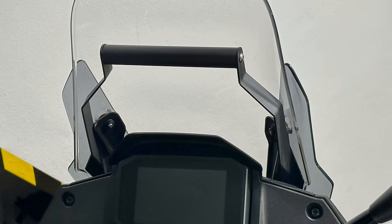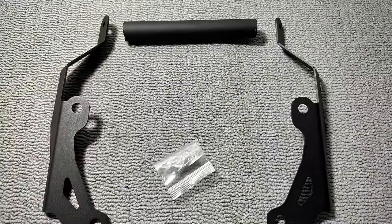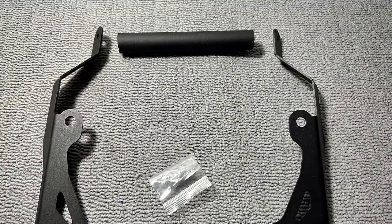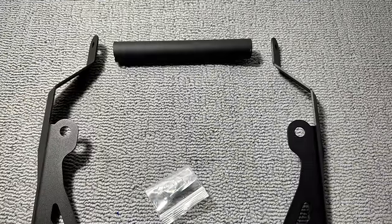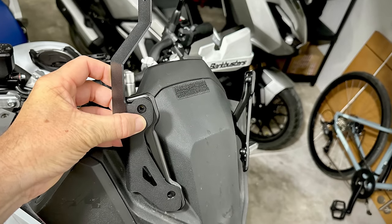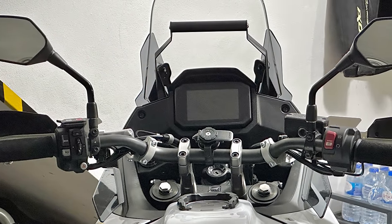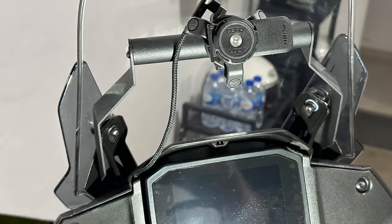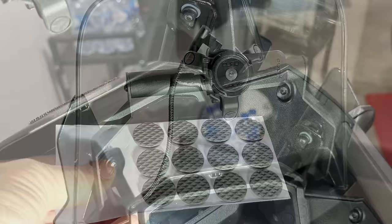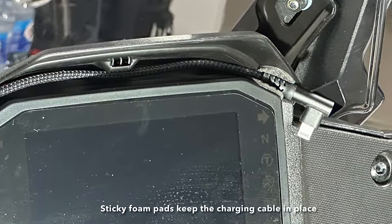The third and final mod in this video is an accessory bar. I had originally fitted my phone mount to the centre of the handlebars, but this wasn't great as it meant taking my eyes off the road to check directions, and it also made my tank bag's release mechanism hard to access. AliExpress to the rescue with this €12 bar originally designed for the Honda NC750X. The vertical brackets attach directly to the screen mount, and then it's just a case of screwing everything back together — no instructions provided, but it's pretty self-explanatory and only took about 15 minutes. The finish of the horizontal bar feels a bit lightweight, but it does the job and everything is held very firmly in place. I added two rubber washers at the end of the horizontal bar to further reduce vibration, and the phone seems just as happy there as it did lower down on the handlebars, and of course it's much easier to read.